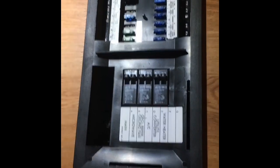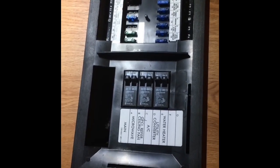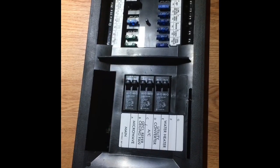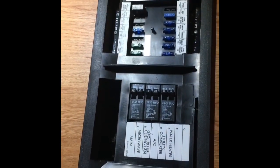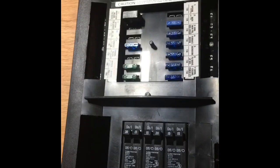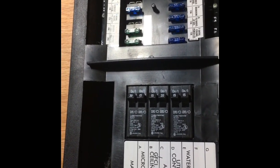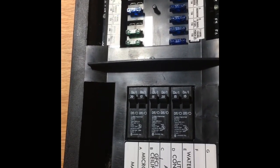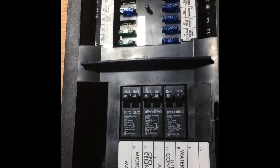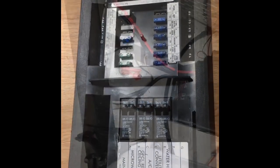The first thing you need to do is shut off the battery charger in your RV. The reason is that if you plug your RV into your inverter, it's just going to constantly try to charge the battery you're drawing power from, creating a loop. On my particular RV, I don't have a breaker or fuse I can remove to turn off the charger. I thought I could shut off the converter, but whenever I did that it shut off everything, and running my RV off the inverter produced no results — none of the outlets worked.